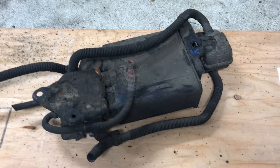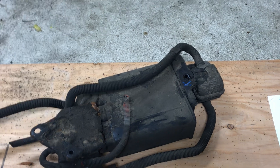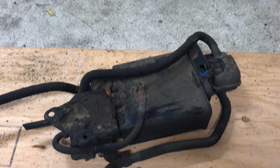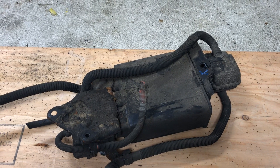According to Google and all the forums, everyone's saying this is the sensor on top of the sending unit below the rear seat — kick it up — but it's not there. On 2003 and 2004 those cars use a steel tank and they did use the sensor on the sending unit.